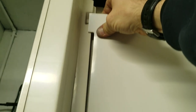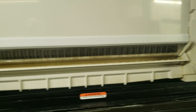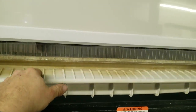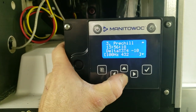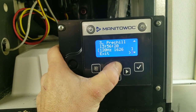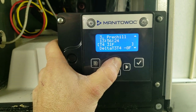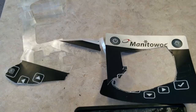In the past I've had a few issues where these trigger mechanisms — forget the exact name — can bow sometimes, get hung up, and won't retract, causing the machine to lock out on a bin-full condition. Everything looks good here; our temperature drop across the coil looks pretty much in line for as quickly as we've just started the machine.